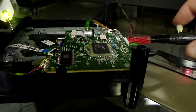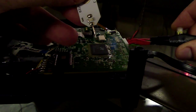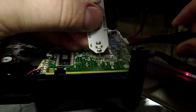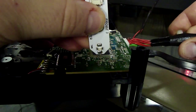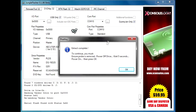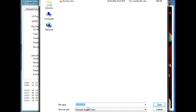On your cable you have a little switch which controls the LED and power on the probe. So what you're going to do is turn the power off and put the probe on. You're going to click yes, power down the probe, turn it on, power cycle the drive, and hit okay. And if you look, you'll be left with dummy.bin.